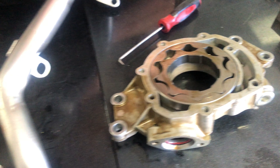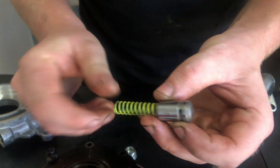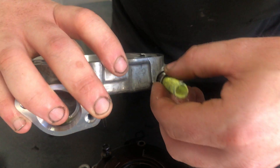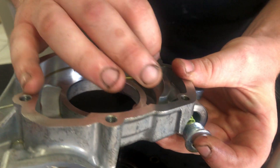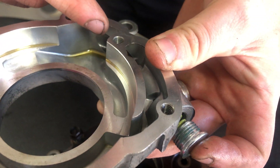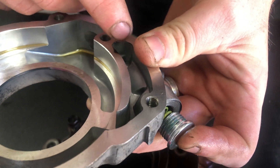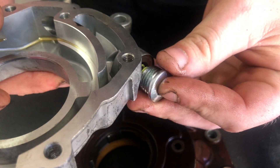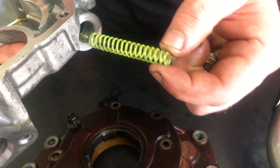The way that works is it's just a piston with a spring — it slides up there, and a bolt forces it all the way closed. As it builds up oil pressure, it's going to dump excess pressure and keep opening and closing to maintain the maximum pressure desired, and that's decided by that spring.